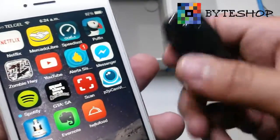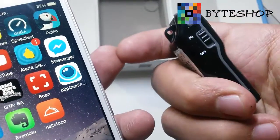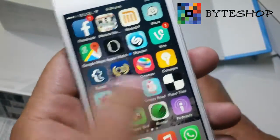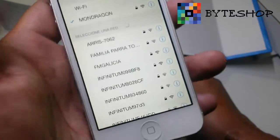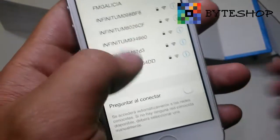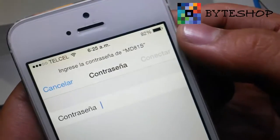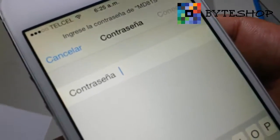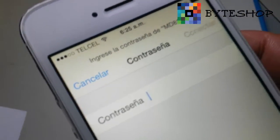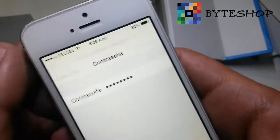Install the app, then go to the camera and put the switch down into AP mode and turn the camera on. Wait about 30 seconds, then go to your Wi-Fi settings and search for the camera. It will appear as a Wi-Fi network called MD — here it's called 81S, but the final numbers may vary. Enter the password, which is 1 through 8, and connect.